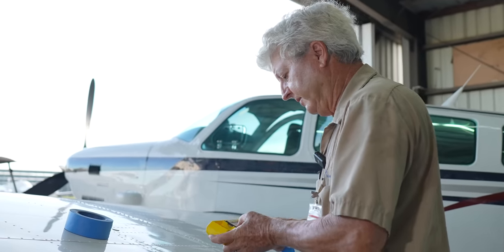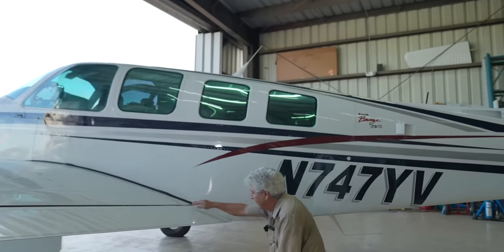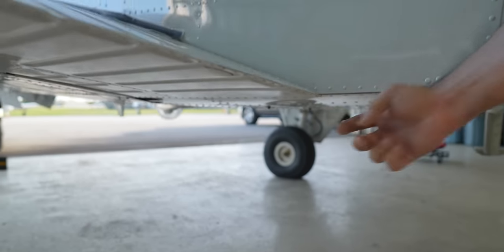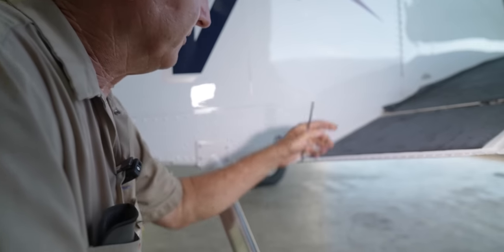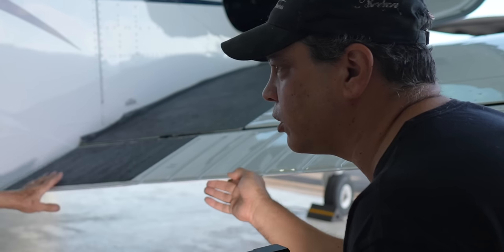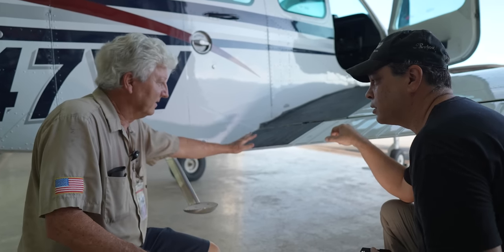Now it would be a matter of flying. We're going to straighten out the tab, but first look at the flaps. This flap is not up nice and tight — it's hanging down a little bit from the trailing edge of the fuselage. There's a gap here; it should be level with the bottom of the plane but it's down a little. Checking the other side — that one's up a little. So there is a difference in the wings, and the fittings show one is adjusted up and one adjusted down, giving more lift on one side.